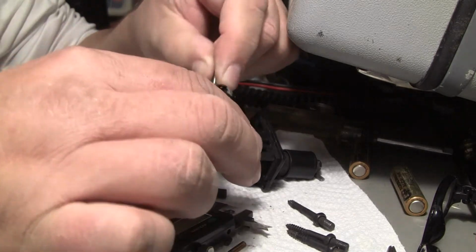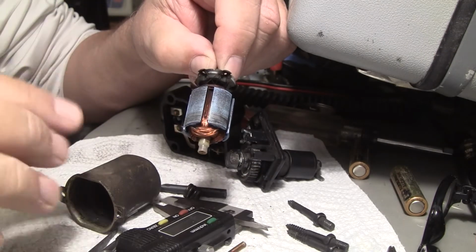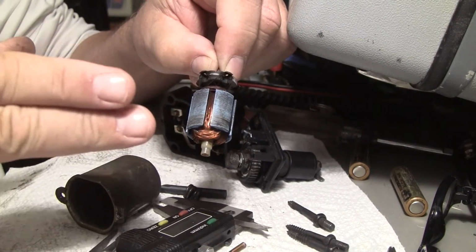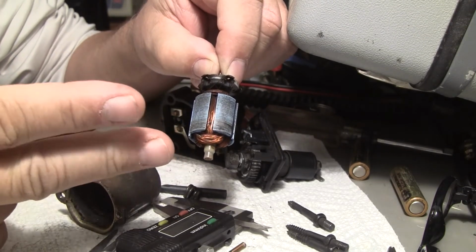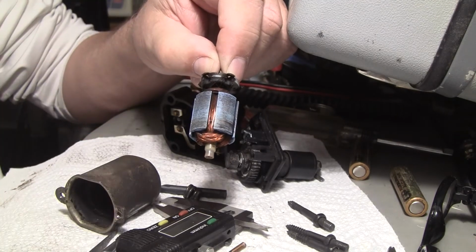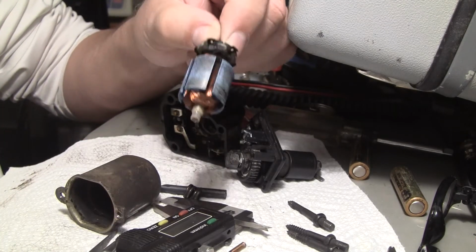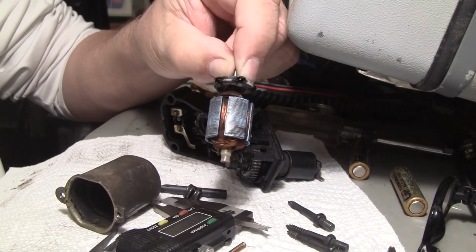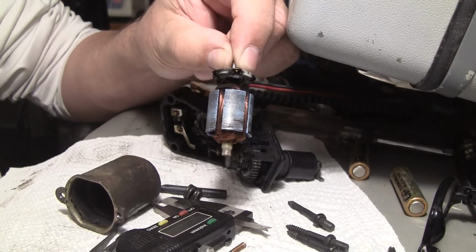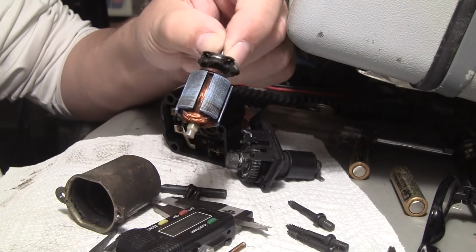And it's like a servo. It's a DC motor, but it goes both directions really fast. So it can adjust the idle, like when you turn on the air conditioner, it bogs your motor. This will turn and spin it up a little bit so it speeds the motor up. Things like that. So this is what they did before the IAC valves, which are infinitely cheaper, infinitely smaller. Well, sometimes they're cheaper, but not always.